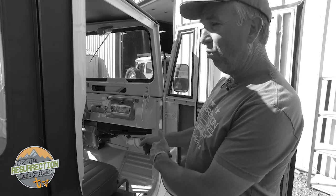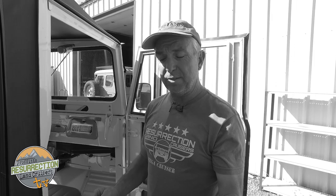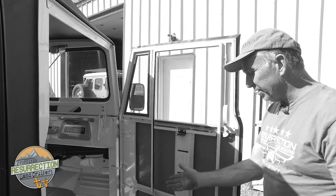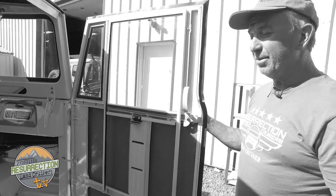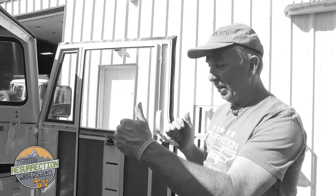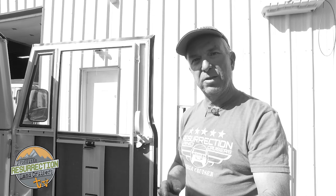There are more random holes on the floor too. How do you tell if holes are supposed to be there? OEM holes are always round, symmetrical, or in a precision arrangement — they're never random. Holes drilled by people are almost never perfectly round and sometimes have a triangular appearance. The holes on this FJ40 floor are definitely random, on both driver and passenger sides. To fix these correctly you'd have to grind to bare metal, weld them up, grind the welds, do bodywork on both sides, and respray the whole underside — that's thousands and thousands of dollars. Do it right the first time.